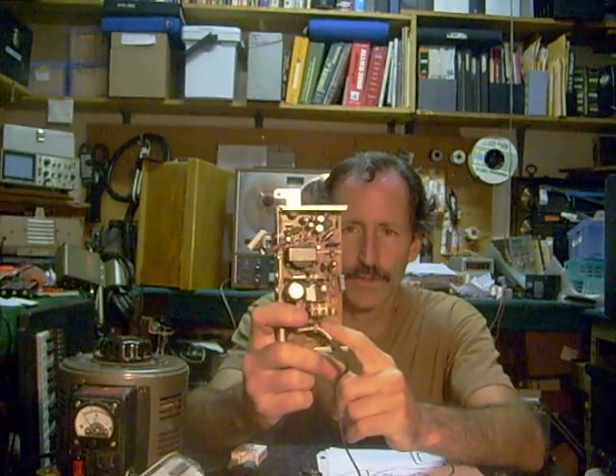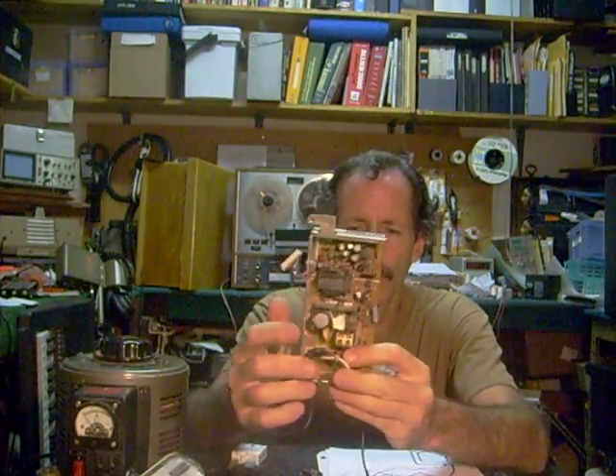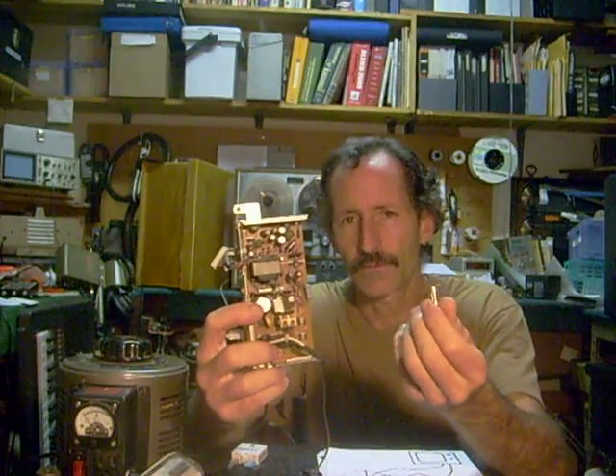Well, most of the time it doesn't fix it. Once in a while they get lucky — there'll be a power surge that'll take out a fuse, but that's rare. Most of the time the reason a fuse goes bad is because something's wrong with the circuit, which is making it draw too much current. For example, this particular TV power supply was supposed to draw only one amp. When a component short-circuits inside, like a transistor, it may draw five amps. So if you have a three amp fuse in there, it's going to blow.